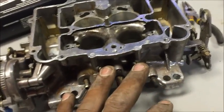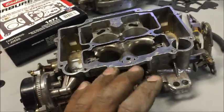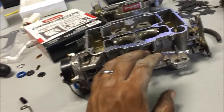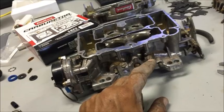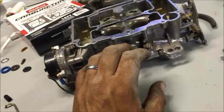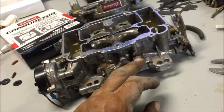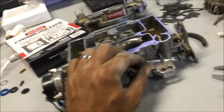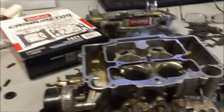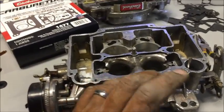That's for every single carburetor, and then we're going to adjust it after it's on the vehicle. After it gets put back on the vehicle, if you hear it spitting — it almost sounds like it's spraying — then you're going to take and turn this in a quarter turn on both screws. If you don't hear it and it's sucking, then you're going to back it out just a hair. Actually it's the opposite: back it out if it's spraying and in if it's sucking. You shouldn't have to adjust it more than a quarter turn either direction. On the 750s sometimes a half turn because you need more air, but on the 550s and 650s, not more than a quarter turn.